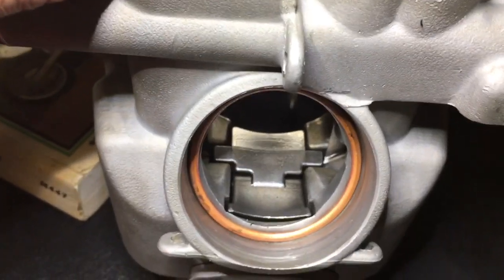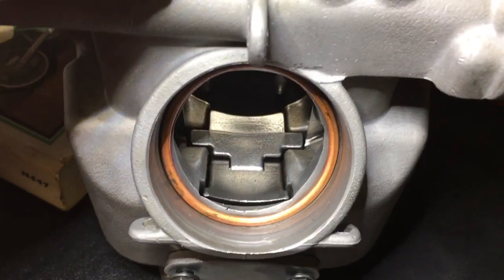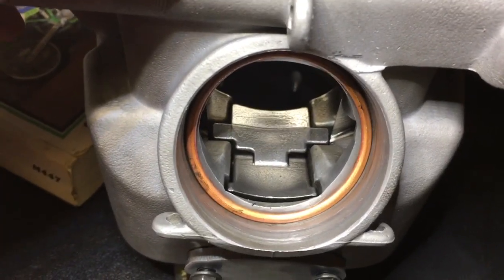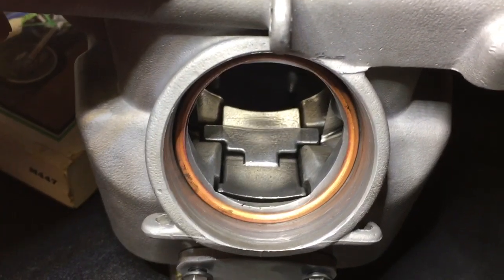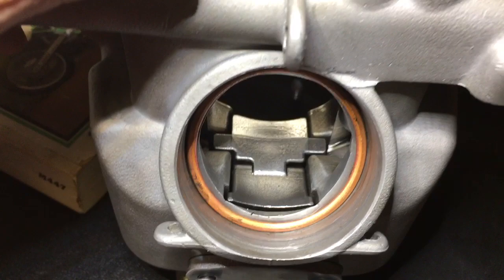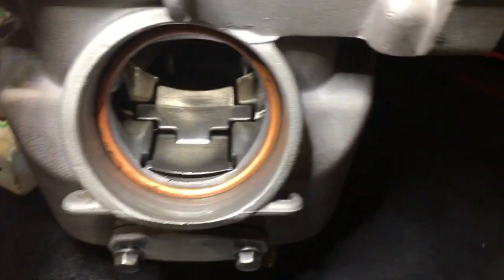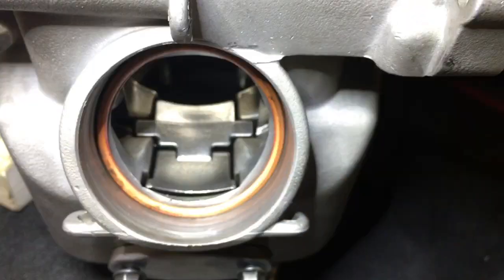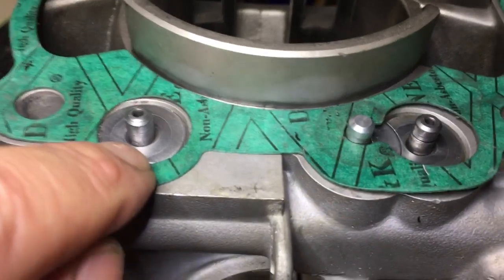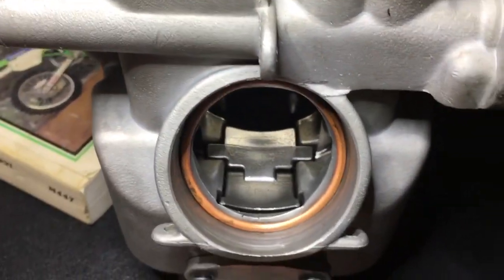When this drops into the case, you see this valve flapper — which is basically the top of your exhaust valve port — basically drops. So you essentially drop your exhaust port timing, which might be good, but the way it's designed, you need to get this exhaust port as tall as OEM spec. When you have wear and other things on the parts, instead of getting new ones — which are no longer made — we'll shim these a little just to make up for that, so you have the tallest exhaust port height possible.